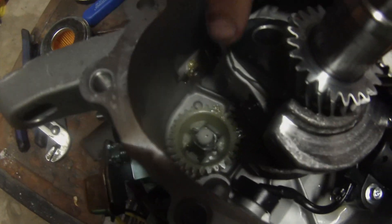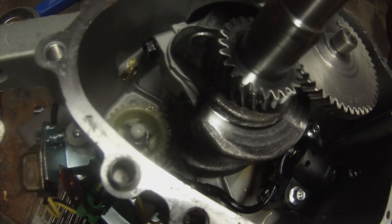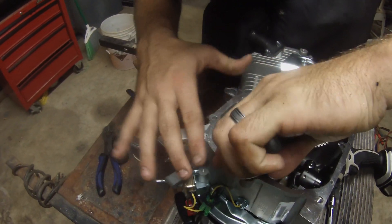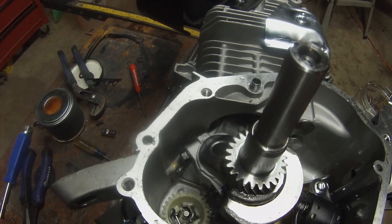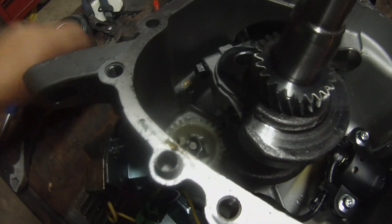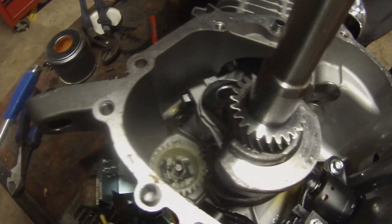If you look down in there, there's a cover right here, and right under there is a little metal clip we're going to take out with a flathead and a hammer. Let's see if I can get that cover off first. There's your cover — it's got a little washer underneath it. Don't lose it — you don't want anything rolling around in your crankcase. Getting the clip off of that gear is really difficult. It's really hard to get off from around that shaft — those will fall in your way, and that's going to be the hardest part about removing this gear.